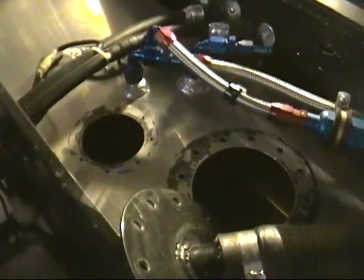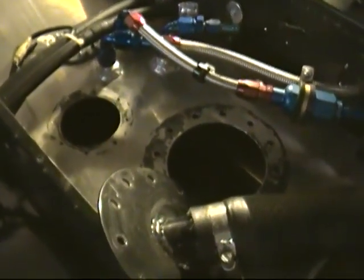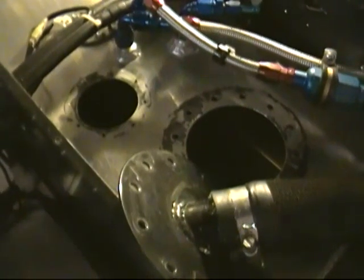...you go around a corner and the fuel sloshes from one side to the other, and the fuel pump will run dry. So I'm building a baffle — a small box in here — that'll hopefully take care of some of that.